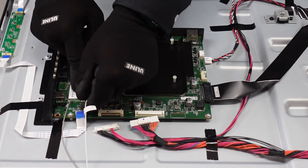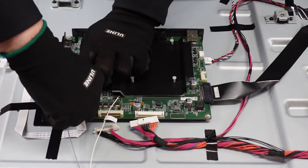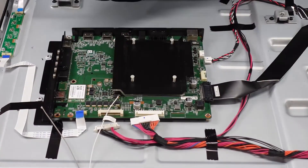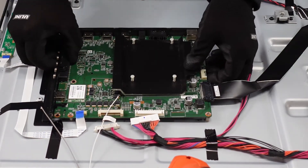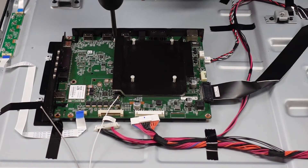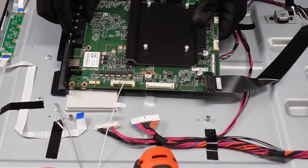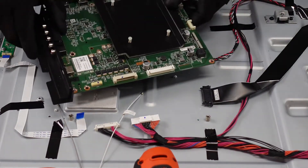And then these two antenna cables just gently lift up off of this Wi-Fi board — both of these here. And we are set to go; we've just got some screws. Be sure to hold onto your flashing here on the sides. It feels like there is some adhesive — nope, we've got a screw right here. Getting ahead of myself today, folks. Get that out of the way, and at this point we can lift up on this. Do be careful, there is still some adhesive holding this into place. That comes up just fine — you can see the adhesive there. And you can hold onto this flashing here to use on your next main board.